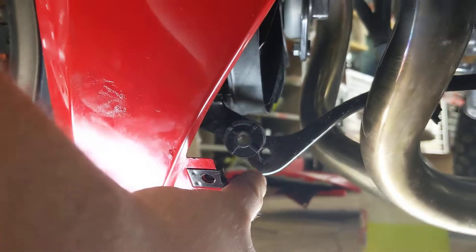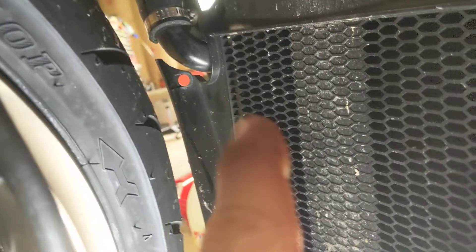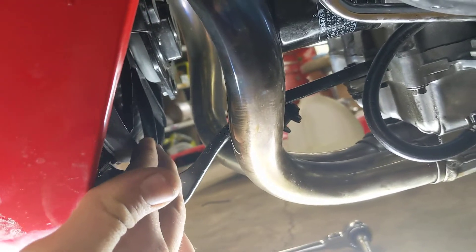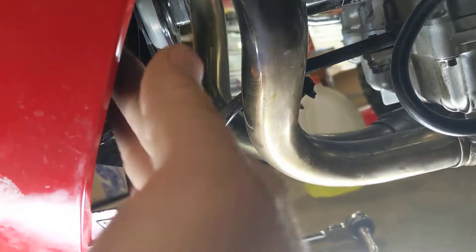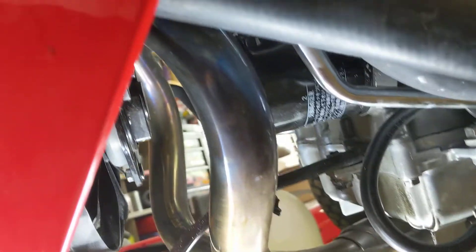So what Honda wants you to do is take the bolt out of the bottom here, go to the front — you can see there are four fasteners to take out. After that point, you can push the radiator forward and out of the way, and that gives you enough room to wiggle out the filter. You are still going to need a cup wrench in order to remove it and replace it.